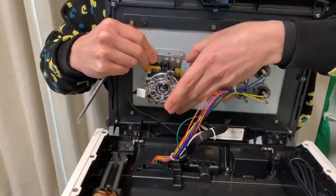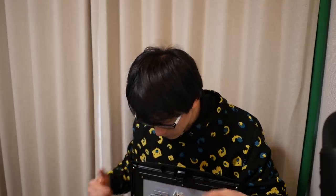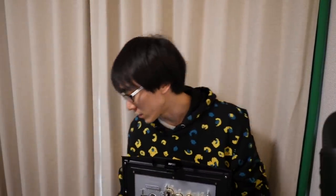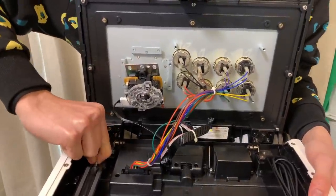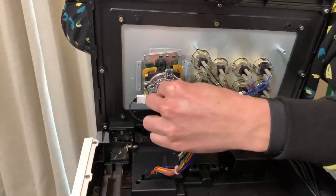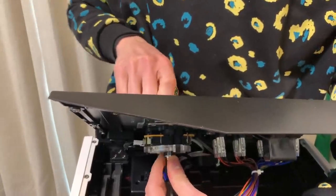There were only four screws and now I can take the... ah, this is the problem. I've taken the lever out, but I haven't taken the ball top off. I have really screwed this up. I need a flathead screwdriver. I went and got my own pocket knife flathead screwdriver, and I completely forgot that there's actually one built into the Mad Catz TE2 Plus — sitting in here ready to do stuff like this. You have to hold this in place with the screwdriver, then with your other hand, you twist the ball top off.